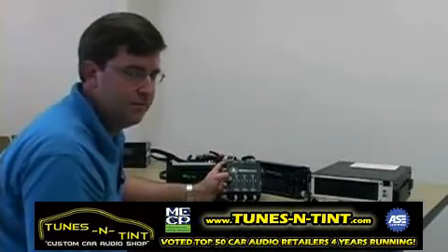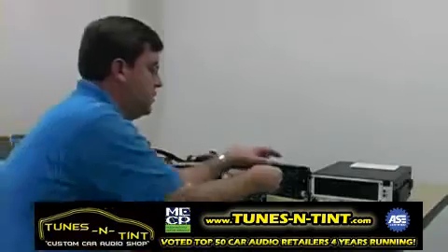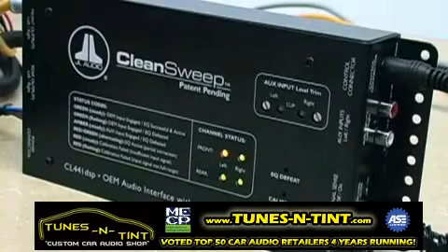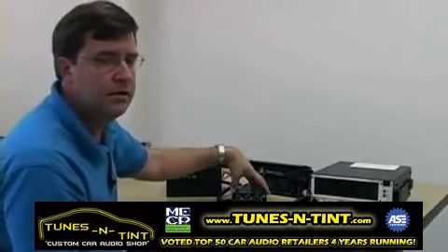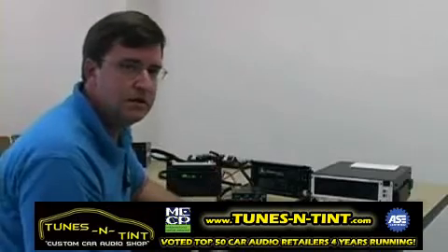Now we have three green lights, and three green lights is always a good thing. From that point, you simply take your Precision Clean Sweep Calibration Tool and recalibrate the DSP unit. And hopefully instead of those red lights and red-and-green alternating lights, we'll get four nice green lights when we're done — that means we've achieved a good correction result. The SSI was able to tell us the relative levels of the signals we were summing, and then this unit is telling you that it has achieved a successful calibration.